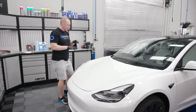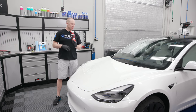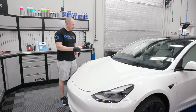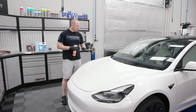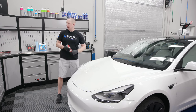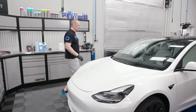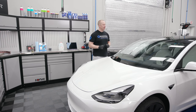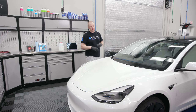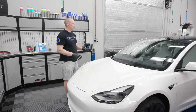I've already prepared the surface. The process is pretty simple: you don't want to take Panel Wipe — which is super aggressive — and soak the whole panel down. You're going to treat two-by-two sections. They even recommend you spray it on the towel; I like to spray it on the panel. Just wipe it and proceed. Be careful with Panel Wipe — don't go crazy. Same thing now. Panel Wipe dries instantly, so you don't want to do too large a section.